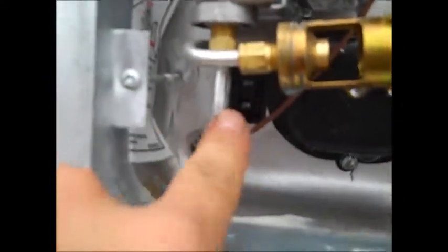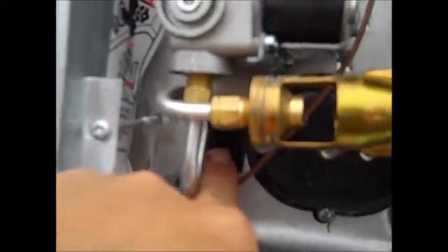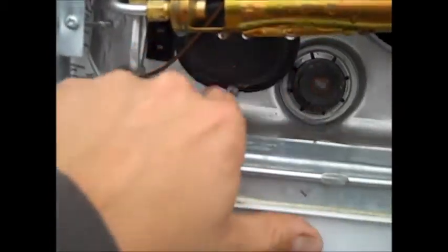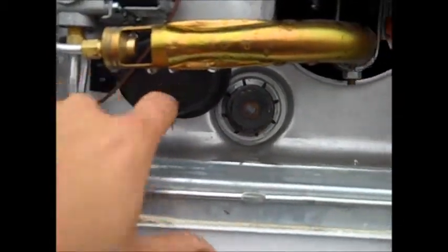To do it on electric, you actually physically have to come out here and push the button to on. There's another switch inside I'll show you later in the video. That's the other main switch on the inside. You have to have them both on for it to work. When you winterize, you come out here and you turn this one off, so if you accidentally flick that other one on when the tank is empty, you don't burn out your heating element.